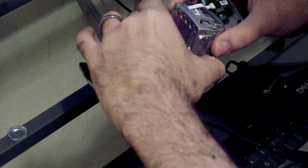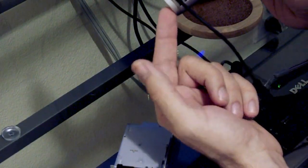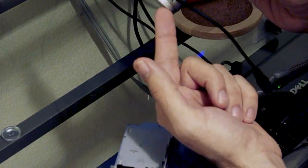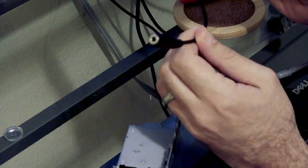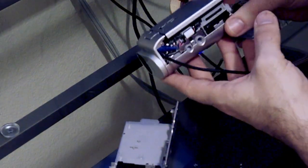This comes out, and if you guys can see right there — excuse the blue tape, that's all I had in the house at the time — but this little white connector with the red and black coming off of it, that actually goes into the microphone in the front. And this microphone is very jumpy; sometimes it will be kind of soft, then it will get loud. So what I went ahead and did was put a small little phone plug on it, so I can get one of those standard boom microphones for a camcorder — something of nice quality so I can do much better audio quality videos.